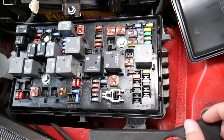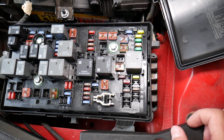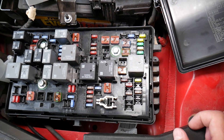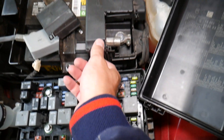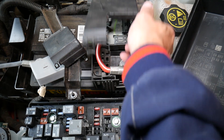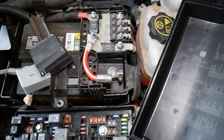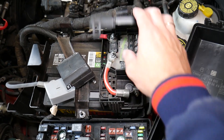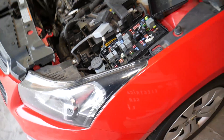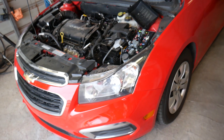If all that checks out, a couple of fuses to check: number 31 — it's primarily for ABS but it's actually part of the turn signal loop as well, so check fuse number 31. Also, right here on the top cover on top of the battery terminal, you have another fuse block. Use a multimeter to check all of these fuses because some could be causing that trouble as well. Hopefully this video will be helpful — thank you for watching, please subscribe to the channel for more videos, and see you guys next time.